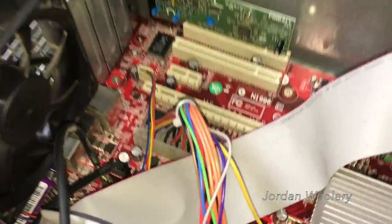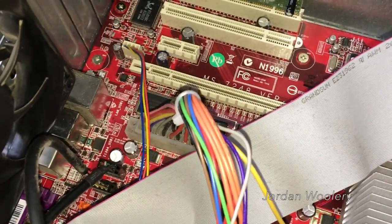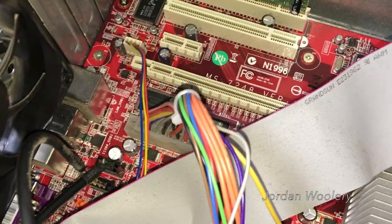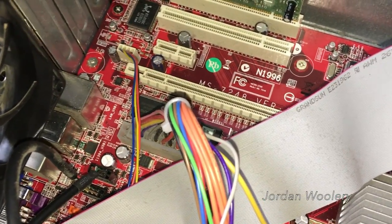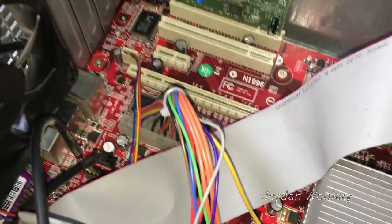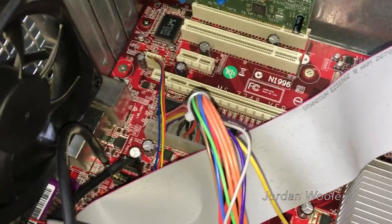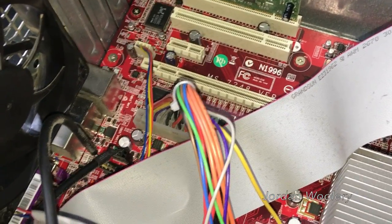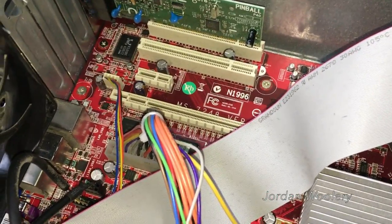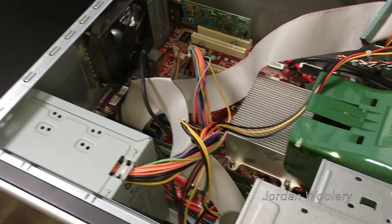This actually does have a PCI Express x16 connector, so I can plug in a more powerful graphics card. I might tinker with that because I have a little AMD Radeon HD 6350 lying around that I'd like to try in an XP system — see if I can make it better for playing older DirectX 9 titles. It only has 512 MB of graphics memory so it would make for a pretty interesting little DX9 GPU for an XP build.